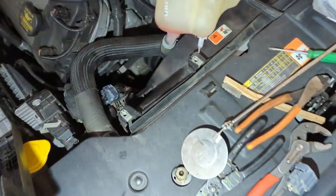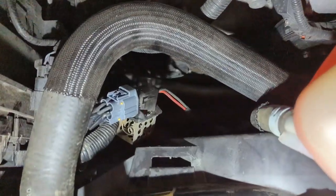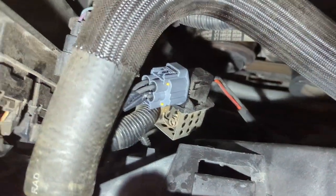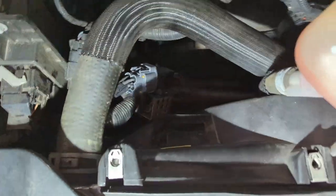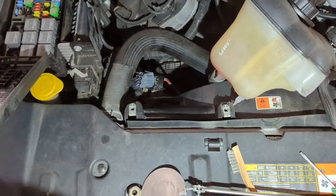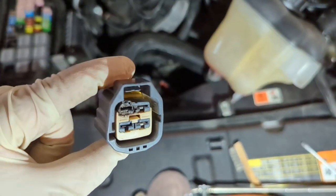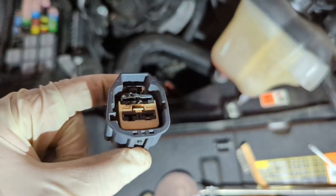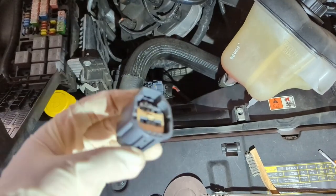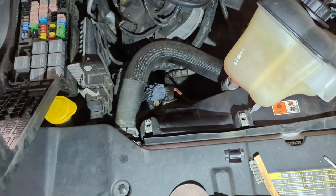Tore this thing apart. If you take a look here, I've got it pulled apart. That is my coolant fan wiring, that is your cooling fan resistor, and that's the plug. I've already kind of fixed it. There's my old plug — look at that, it's all melted. So basically, when wires melt there's a problem and you're basically just going to have to replace the pigtail. And that's what I did, as you can see there.